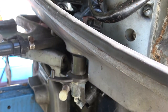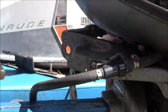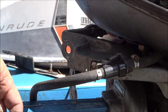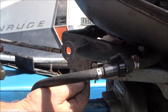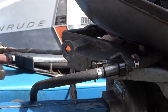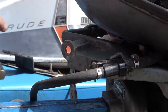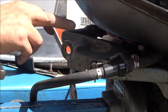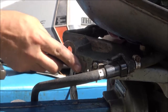Let's get this thing put back together — the tiller handle — get it put back together and greased up, and we should be ready to go. Now we're going to put this back in. We're going to use a little bit of grease. Put this down underneath here — there's another hole; make sure you clean it out, that's to spur your lubricant up in whenever you do your servicing. Now that should spin free, and it does — nice and free. I also sanded this off on both sides, made it nice and smooth, and that's for our handle.